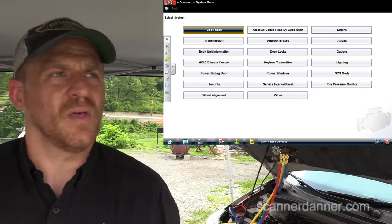Control is good. Now we need to address our load side — the two heavy pins. I have a tool for this that has actually allowed me to be very safe in this next test. I know I could jump the load side, and you could too — take a loop with two female terminals and jump the two load side contacts — but if you jump the wrong pins, you cook the computer.